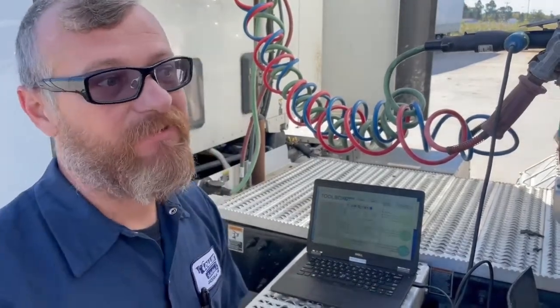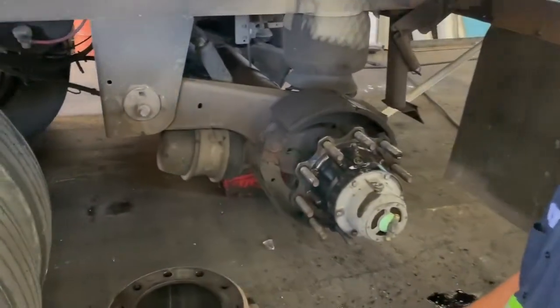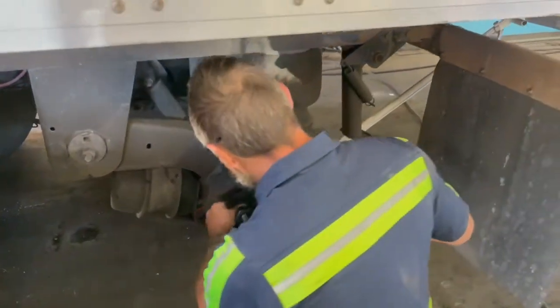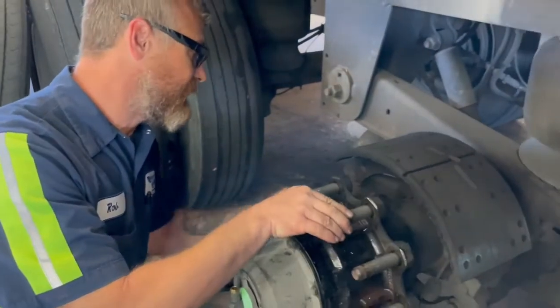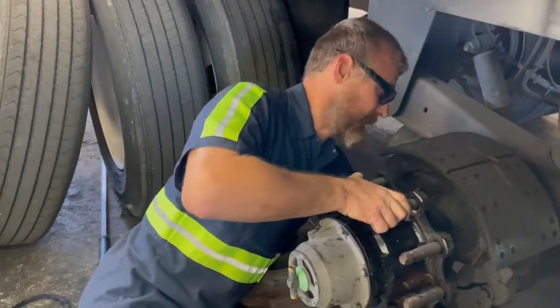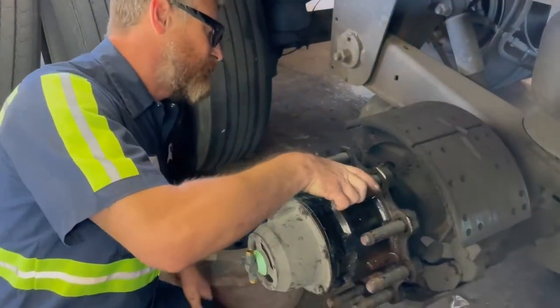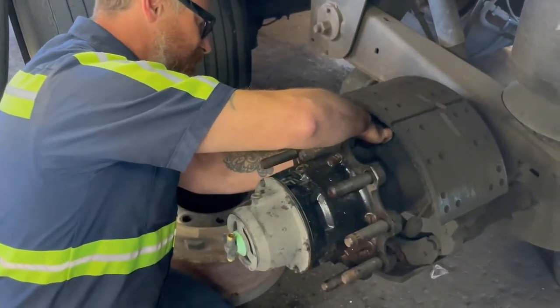So there's a break in the ground, so I'm going to have to go back here and see what's going on. I've already taken this apart because I was changing the brakes and I changed the hub seal. So the computer said it's going to be the rear left sensor. I'm going to look at this sensor here and make sure the wiring's good, make sure it's plugged in because there's a plug on the back here. And that's plugged in — make sure it's adjusted correctly. It looks like it's a little out of adjustment, so I'm going to push this in a little closer to the hub.